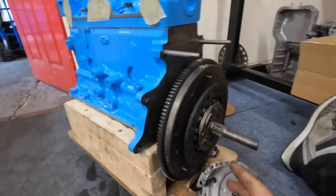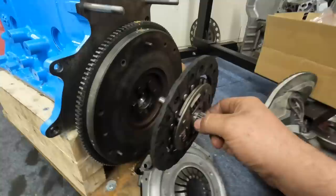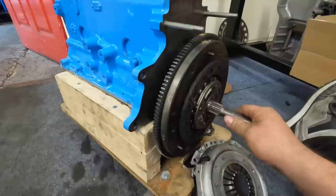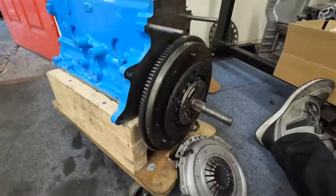I'm finishing off the Formula Ford engine and putting the clutch on now. The clutch has got two halves - a flat half and a part with a spline and springs to take some vibration out. It's important to make sure the clutch goes on the right way because if you put it on the wrong way round this part will bottom out on the flywheel bolts and the clutch won't work. I use an old bit of input shaft - basically inch diameter 23 tooth, cut straight out of a gearbox input shaft - as an alignment tool. Because I've checked the balance of this, I've marked the clutch and flywheel with dots so it'll only go on one way, and then I'm just going to torque the bolts on.